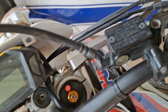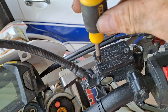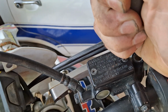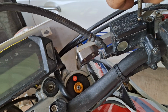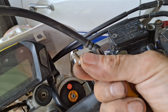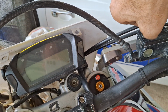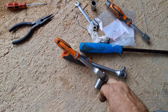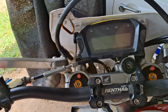Right, first thing we've got to do is get these out. Now you want to always keep yourself a nice virgin screwdriver that's not been abused on other activities, and push down and twist, and these screws should come out. Look at the state of them. That's why they round off, because they get all corroded. Once we've got these out, we're going to carefully put them down there where we're going to lose them. We're going to put some anti-corrosion stuff on them later.